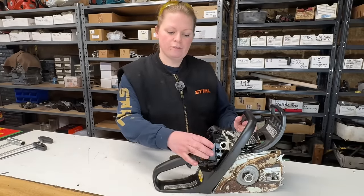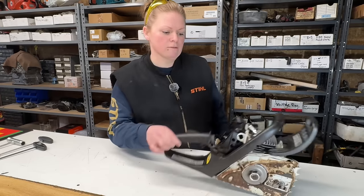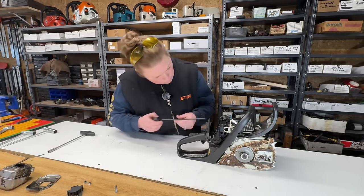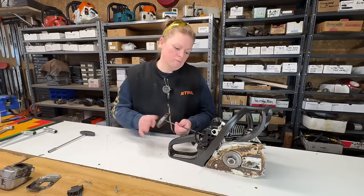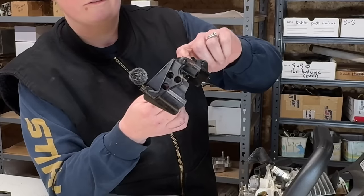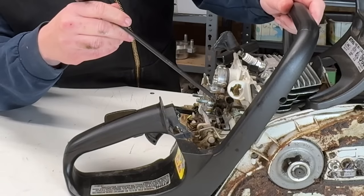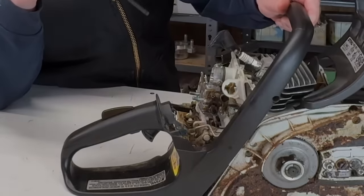Next, we'll take the air filter base off. There's a couple 8 mils in there. There's a couple T27s, actually maybe 3 T27s. Top left one loose. When I removed this, the top left screw was not even tightened down. And now that I have the carburetor exposed here, the high jet, the limiter cap is gone, and there's been a screwdriver jammed in it.